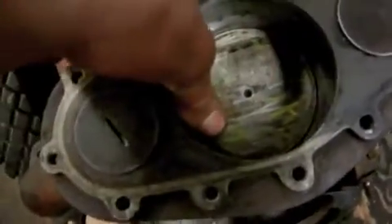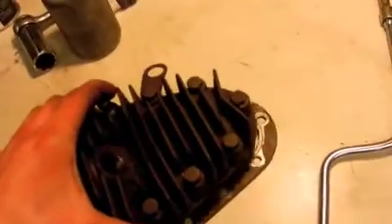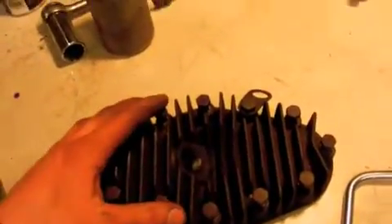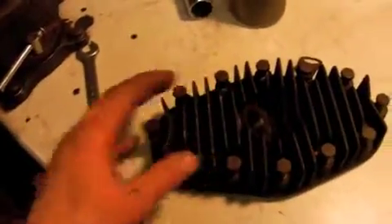The valves are adjusted now, those are ready to go, and the piston moves up and down fairly nicely. I don't know whether you'll be able to see it or not but it's got a little bit of side-to-side play in it, so I don't know if this is gonna be a smoking tractor or not. The underside of this head had a lot of that oily carbon residue that you'd get from a machine that burns a lot of oil, but I got that all scraped off.